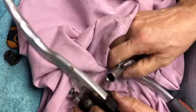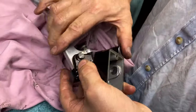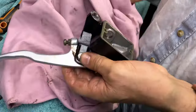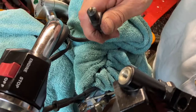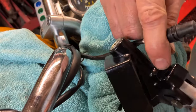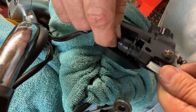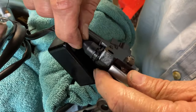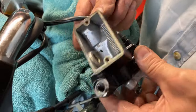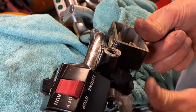It's fairly tight - it's got a nylon nut on there anyway. So there she is, all ready to go back on and bleed the brakes up. We're going to put the brake light switch back in first. You've got to have that flat piece against the flat piece down there. Did you hear that click? Just make sure it's in right.